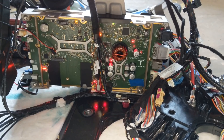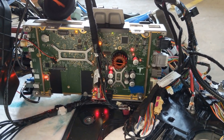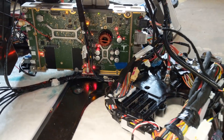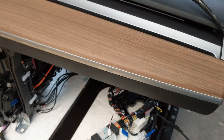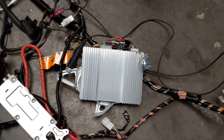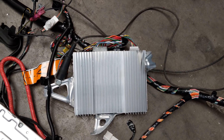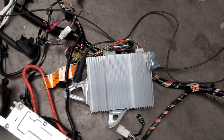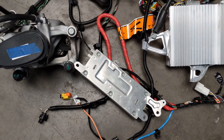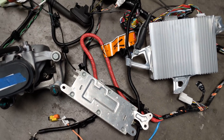Here's the front of the ICE with the cover off, showing the ICE side of things. The autopilot ECU is on the back. Over here we have the premium sound amplifier that handles the subwoofer and door speakers and things. That's the radio tuner, which is normally up kind of behind on the C-pillar.